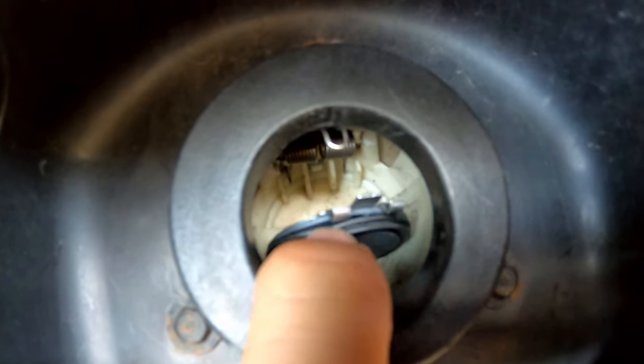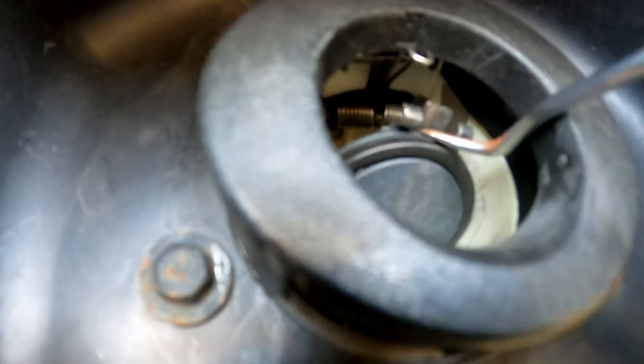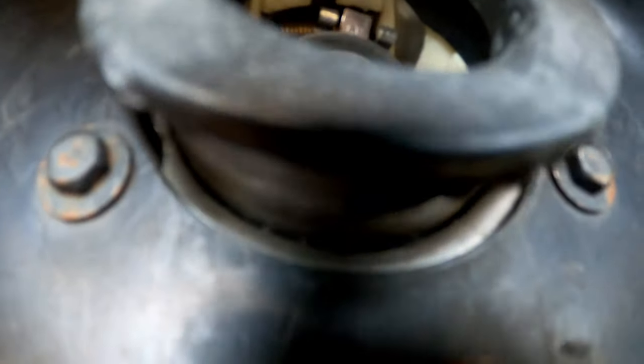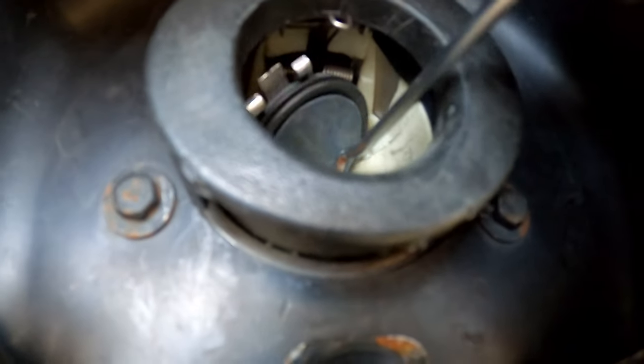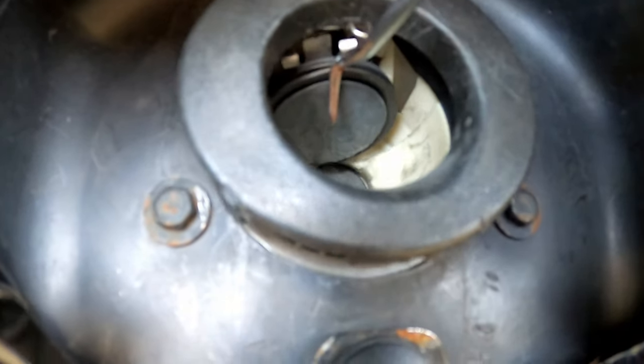See the clip right there? That clip is supposed to clip onto the top. There's a little bar right here that goes across. That clip is supposed to clip onto that bar, and the spring should be under the lid, pushing up to hold the lid closed. But the problem is it's held by that spring only, so eventually it pops off and lays in there. What I've been doing is leaving it lay like that — I push the nozzle in, it pushes the lid open, and the nozzle goes down to the gas tank at that second lid. That's a poor design by Chevy.